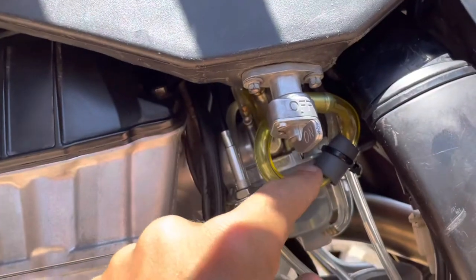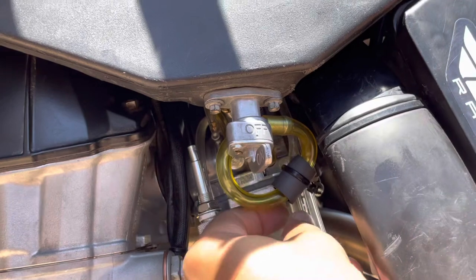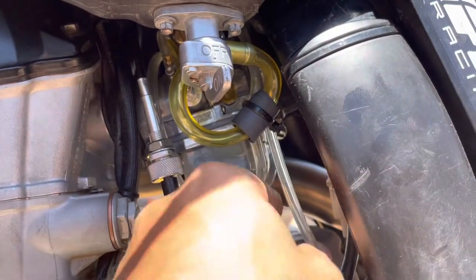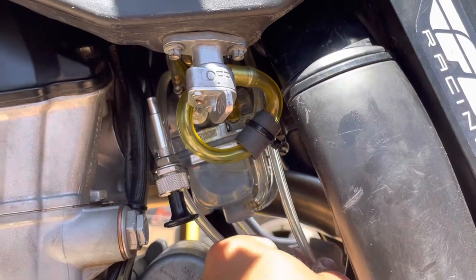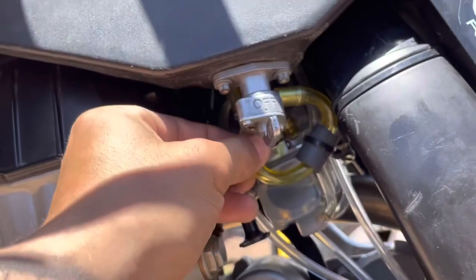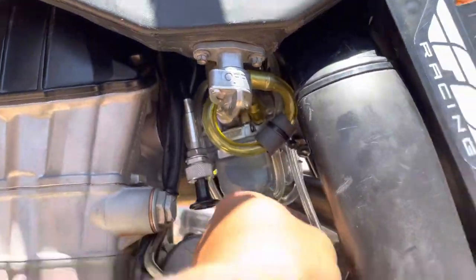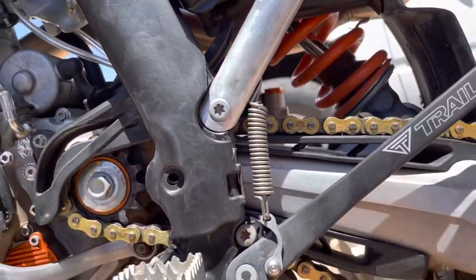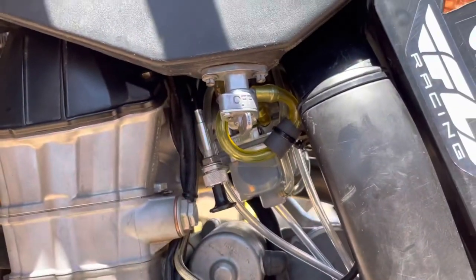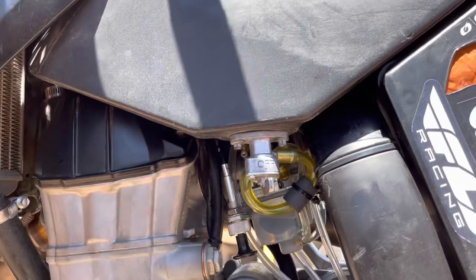So I think this is gonna fix our issue. Put a hose around it to keep it from collapsing, tie strap there to their smaller one. These down here are really thick. These don't collapse. Even the vents don't collapse, but the main fuel line does. That makes tons of sense. You see how thick these ones are? Yeah. These plastic ones? That's good. Why couldn't this one be the same? I don't know. Sure think it would be, wouldn't you? Yeah, so this is the same deal with the instructions. They're awesome instructions.